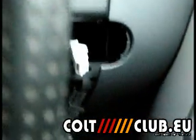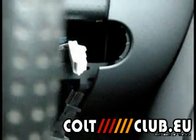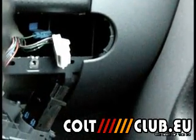Then obviously you just run that wire up to your boost gauge. You can have one wire on your boost gauge for electricity, then you should have one for earth. Earth you can just run down to anywhere — I've run the wire down to a bolt behind the accelerator pedal somewhere down there, but that can be done to anywhere that earths onto the body.